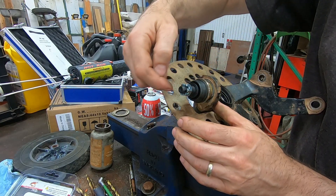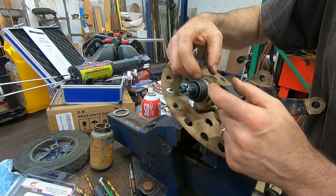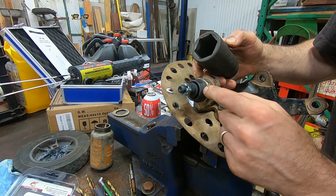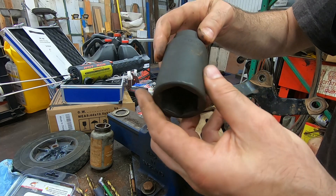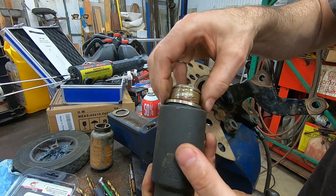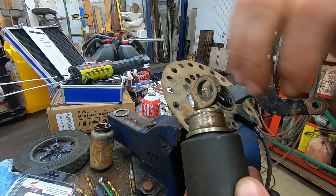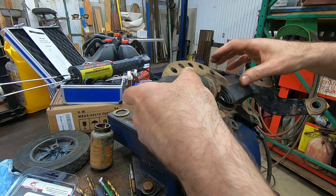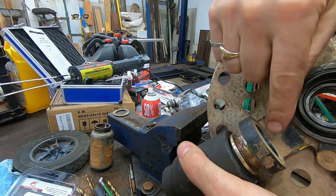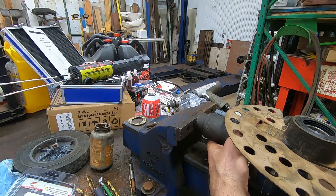You don't want to push on the neoprene ball socket part — you actually have to push on this edge right here. So how do you push on that without damaging the boot? I've got a 35mm axle nut socket that fits right over the rubber perfectly and catches on this little lip. I'm going to press it in part way in the vise, but I can't go much more than about three millimeters or it'll bottom out on the vise — just start it with a couple of turns.